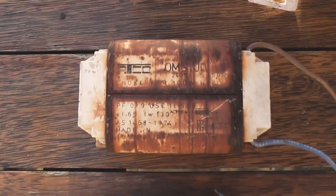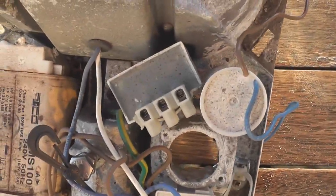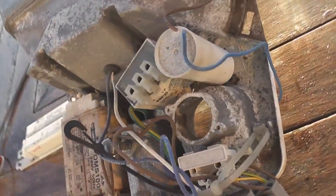That one is defective — that's obviously defective. And this one looks alright; it's still in the lamp, but it's defective as well. I'll bypass the igniter here at the moment, but I'm gonna put it back on the other igniter and see if that one works — it looks alright. The capacitor, the condenser, is okay as well. Let's put it together.